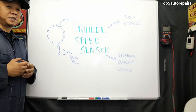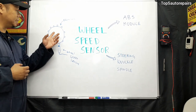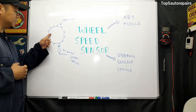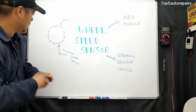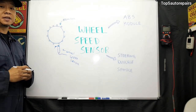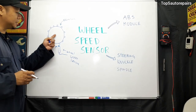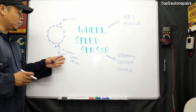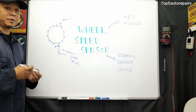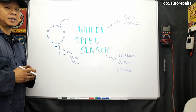What I have here is a very simple drawing of the wheel speed sensor and reluctor. This reluctor is mounted on the axle or hub bearing, and every time it spins, it produces a signal that gets sent to the ABS module. So every time there's an issue — such as a broken tooth on the reluctor, or a wheel speed sensor that gets extremely dirty or contaminated with metallic particles — it's going to trigger the ABS light.